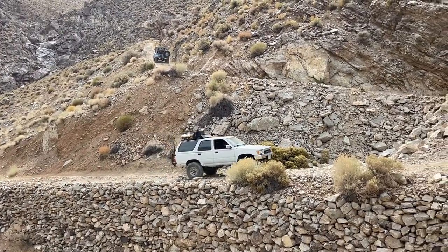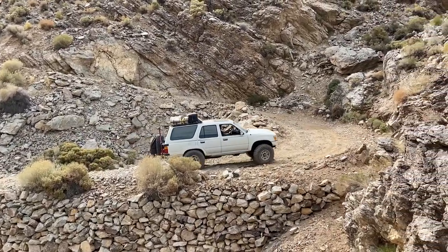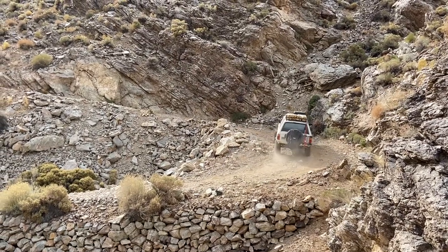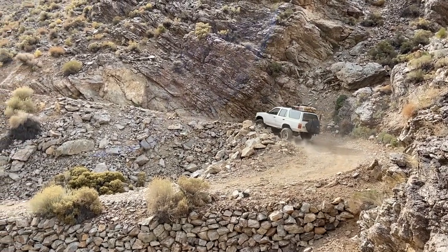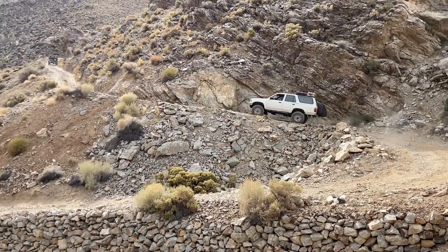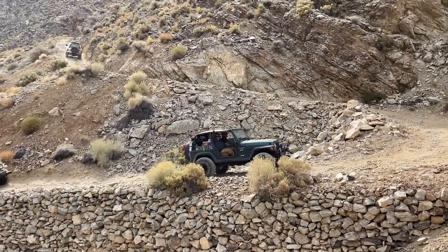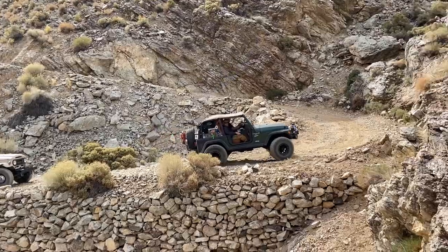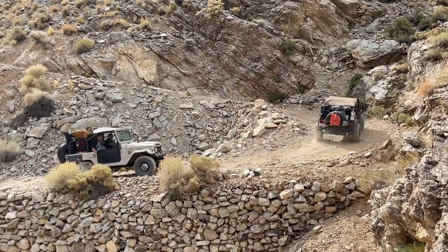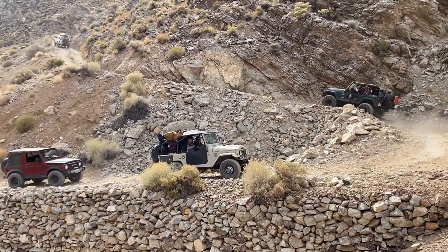So after not being able to find the short, we decided to put a jumper in to see if we could maybe induce a little bit of smoke, maybe a wire could burn a little so we could smell it and isolate the problem. I mean, if the issue's already there, we might as well use it to our advantage to determine what was going on. After doing so, whatever happened, it disappeared. We did move a lot of wires and jiggle a lot of connections, so the problem disappeared. We put a 15 amp fuse back in and we were fine for the rest of the trip.